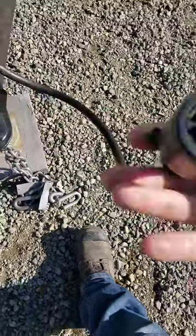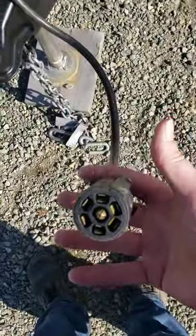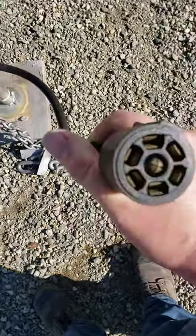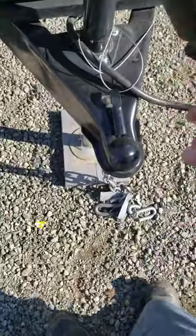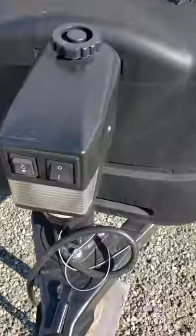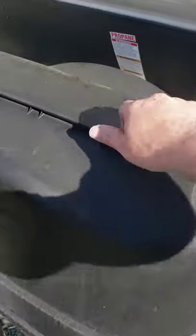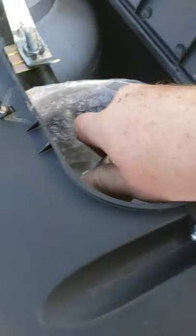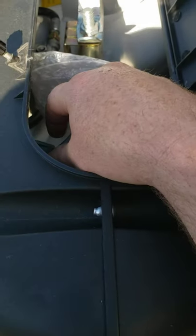Your safety chains need to be on the truck when you're traveling. The 7-pin connector does your clearance lights, brake lights, turn signals, charge cable to your battery, and brake operation. You've got your propane cover with an easy access panel on top — just loosen these little nuts, flip it forward, and there are your propane tanks. They're on right now, and I'll show you how that operates from inside.